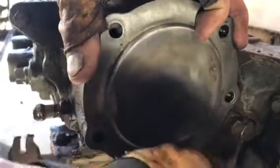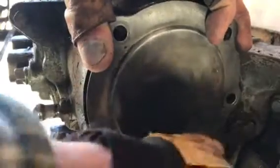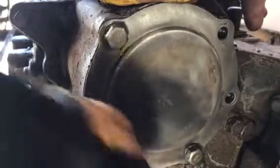This step is most necessary to remove the transmission from the transfer case. For the time being, I'm going to put the cover back on and just tighten the bolts. It's just really easy to do that while it's still attached to the cross member on the frame.